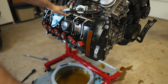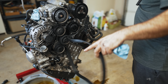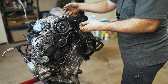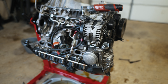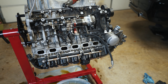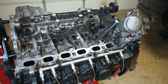All the oil passages are clean, there's no shavings or anything in them, so there isn't really any coolant coming out of the motor. Let's take off the power steering pump. AC compressor comes off next. Next up the alternator. Let's take off my Helix overdrive. I think that's enough disassembly to get into the bottom end and see what's going on.